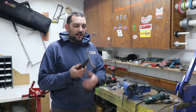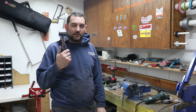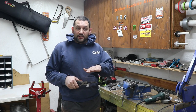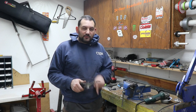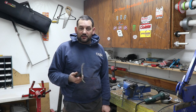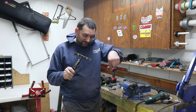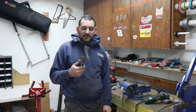This will be my chassis-side bracket. The reason I'm doing two brackets instead of one is I want a small, out-of-the-way one on the chassis, and then I'll bolt on another bracket. I tapped the bracket and put nuts on the backside to make sure there's plenty of thread and it's not at risk of stripping out. I definitely don't want to be fishing a nut down into a tight space, so this will make that a lot easier.